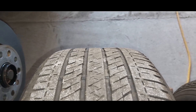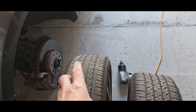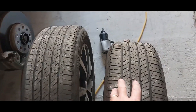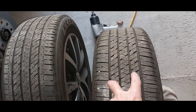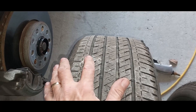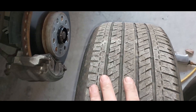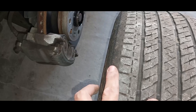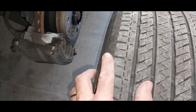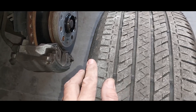If we look at this one, it's not got that much. The tires up front receive a lot more friction wear than the ones on the back because the ones on the back are just trailing — they're just following, so they get very little rub time. When you have more friction, the rubber is going to wear off a lot faster. I caught these just in time. If this kept going, this might wear out a little faster and show the belt, and then I would have to replace it prematurely.